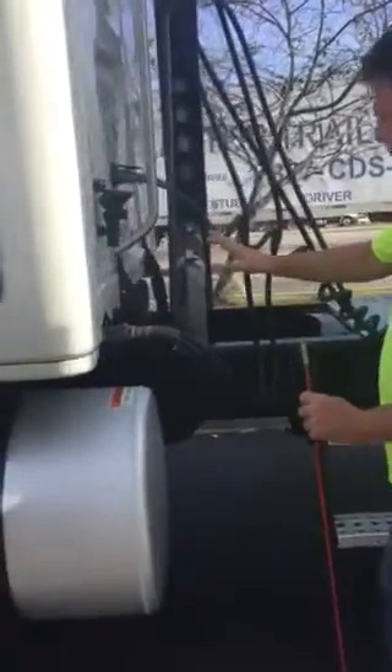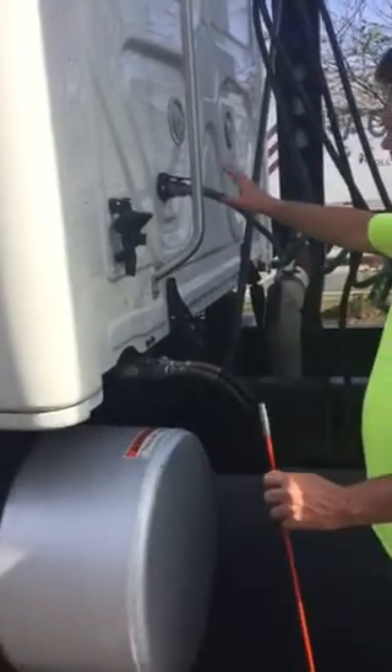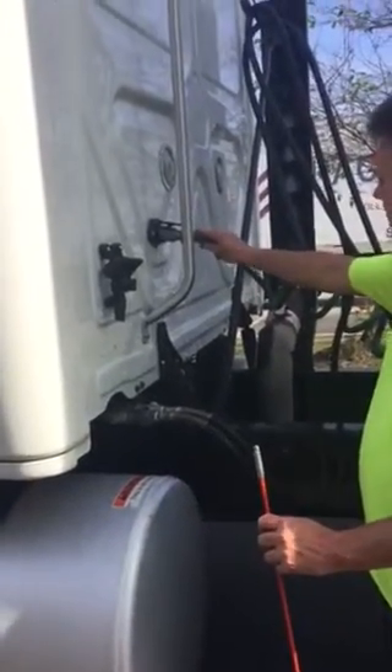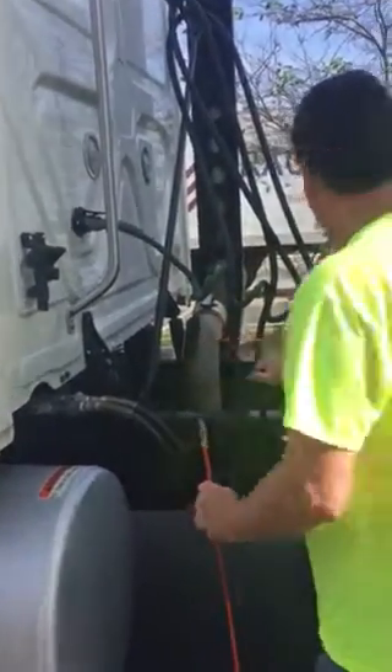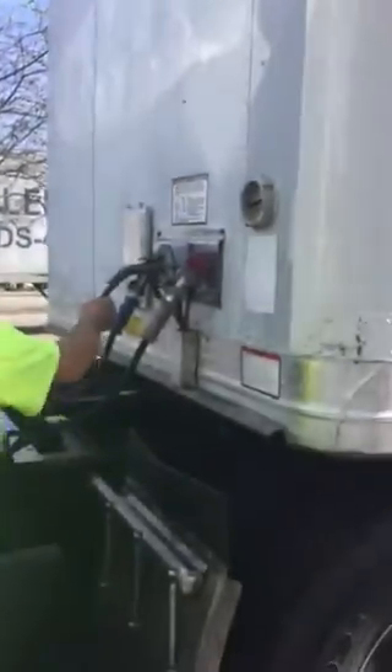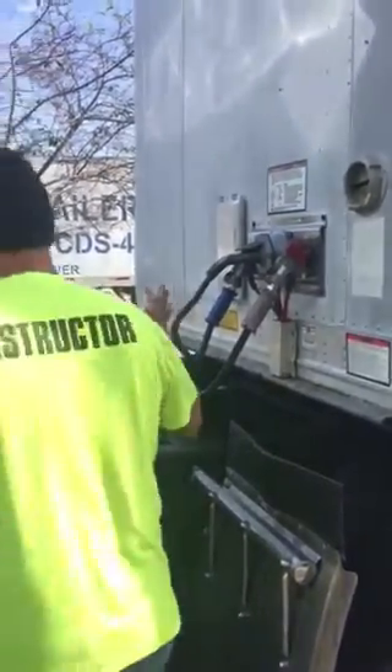You must break this down into two sides — the tractor side and the trailer side. I'll start with the electric line. The electric line on my tractor side is not cut, cracked, dry rot, or frayed, and I see no signs of burnt, damaged, or exposed wires. Then my electric line on the trailer side is not cut, cracked, dry rot, or frayed, and I see no signs of burnt, damaged, or exposed wires.